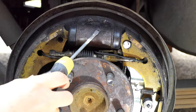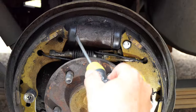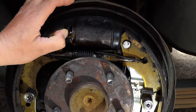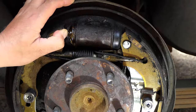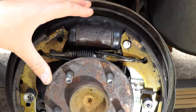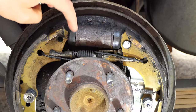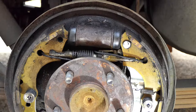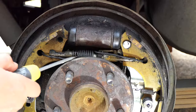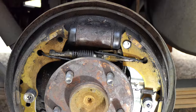You'll see here the wheel cylinder is on the top. Now it should be dry underneath these boots here, but I suspect it is full of gunge. As you can see there, brake fluid is coming out and you don't want that. Brake fluid should not be coming out of that — so that is definitely buggered and needs to be replaced. That's how you know that's the culprit and not some other part of your system. If it's leaking out of those, replacement needed immediately. When I cleaned this last week it was all gunged up with a big blob of oil — just all the brake dust and brake fluid mixed together creating a big pile of schmoo.